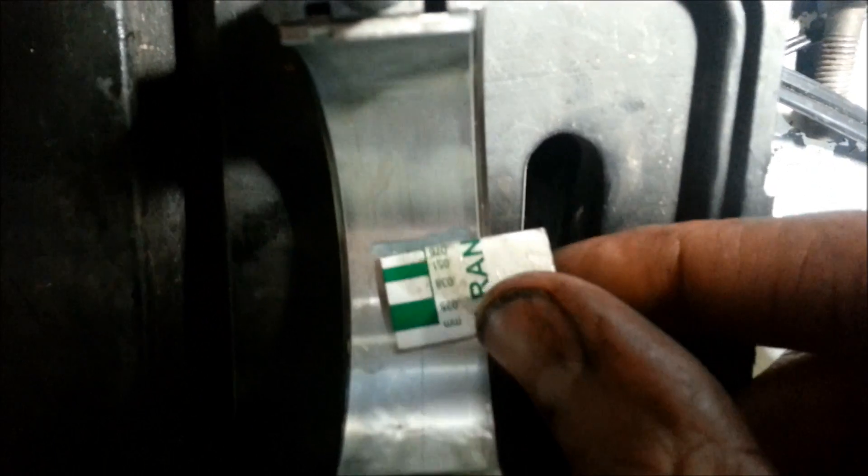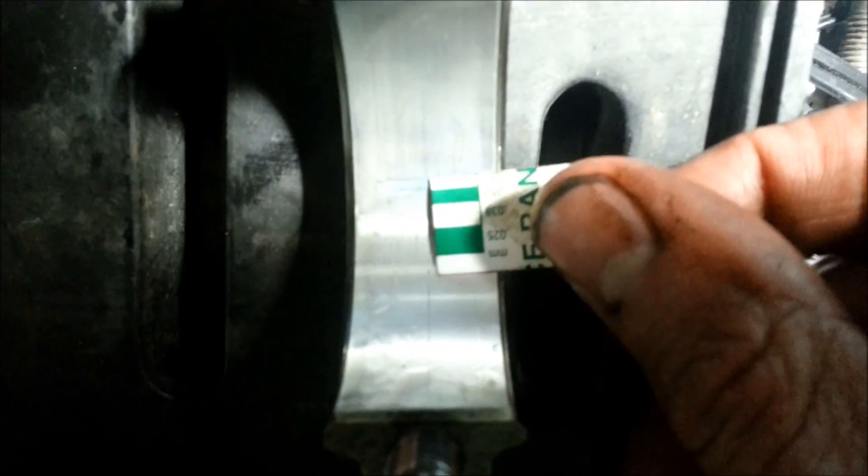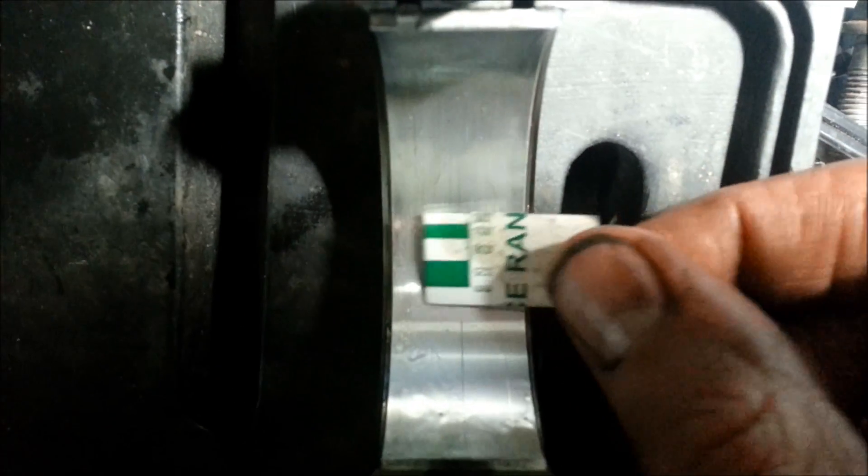Here's the verdict. We have clearance of a little less than 0.076 millimeters, which the manual says is good — it's right there. I didn't torque this all the way down because I don't know how well these rod bolts are going to do and I don't want to snap them off since they've been subject to high shock load from going up and down. I checked it again — it's almost at top dead center now, so I'm going to try it again with it coming down just to make sure. It's probably less than ten foot-pounds of torque, but even with this it's still within acceptable range. If there's any noise, I'd just put a little oil stabilizer in there for now. Thanks for watching.